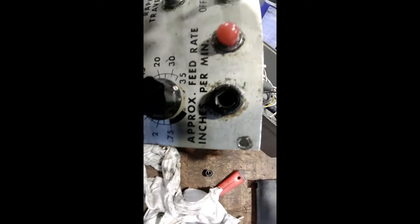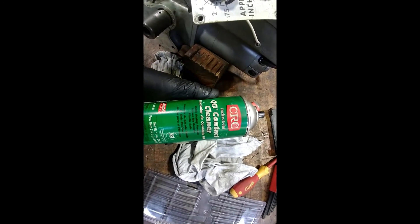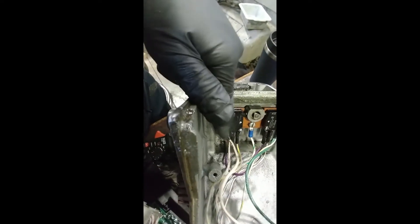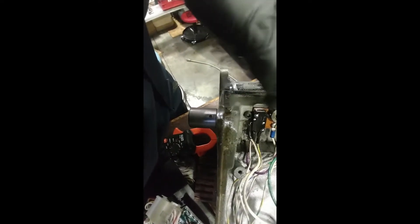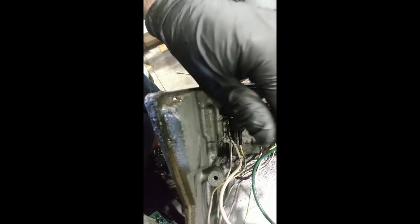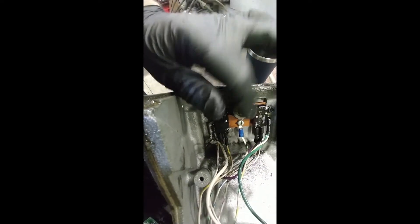I need to get in there with some contact cleaner and flush that out. I'll clean it out — note to self, put Q-tips in the toolbox. This could explain why the right isn't working: the switch is completely loose in there. When you turn the handle to that side it won't actuate the switch because the switch isn't stationary — the plunger won't push. It doesn't explain why the left side doesn't work, but there's grunge on everything and I'll bet these are full of oil. We'll try contact cleaner, take them apart, and see if that helps.